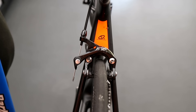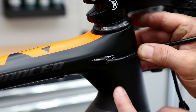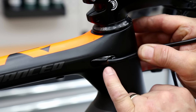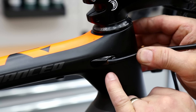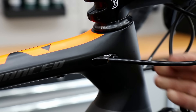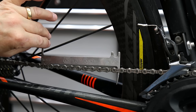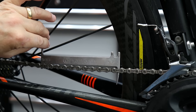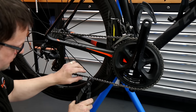Initially when a bike comes in I analyze it. You can see the brakes are pulling the wheel to one side of the forks — that's not good, it's going to wear the wheel bearings and stress the spokes. We've also got quite a few cracks on the outers of the cables, you can see how that's splitting and there's initial surface rust forming where it's deteriorating. The chain itself is way past the 0.5 stretch recommended for an 11-speed, so we're replacing that chain.